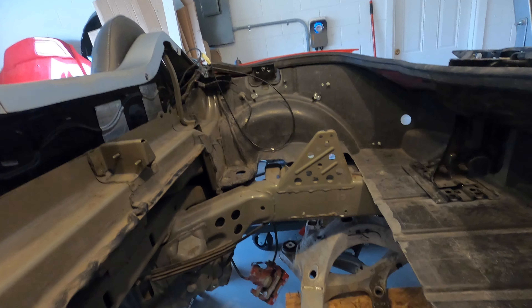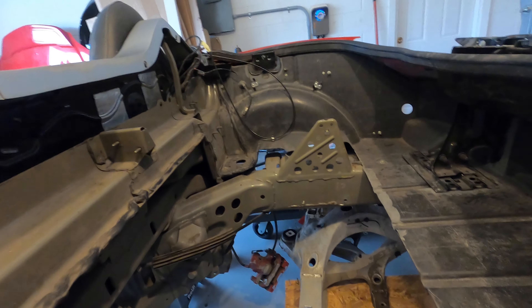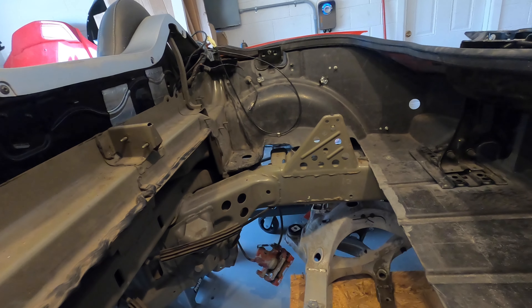That's not ideal for me, especially doing this in my garage with very little welding ability — though I'm definitely going to be getting better at welding due to this project. I need to get this car back on the ground as quick as possible, so we're going to end up building out motor mounts. The frame still needs to be notched for the motor, and when I go to install the battery box, I'm planning to build two battery boxes — one for the back and one for the front.